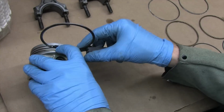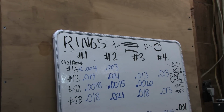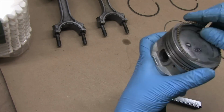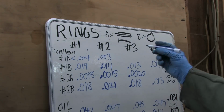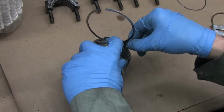But where were we? Oh yeah, ring flutter. If the second ring is tighter than the first, then when the boom happens, pressure is trapped between them. It backfires through the number 1 ring back into the combustion chamber, and the number 1 ring basically doesn't seal during the combustion stroke. If you set the number 2 piston ring several thousandths wider than the number 1, you avoid this condition. It allows more blow-by, but it's worth it if your rings seal better.